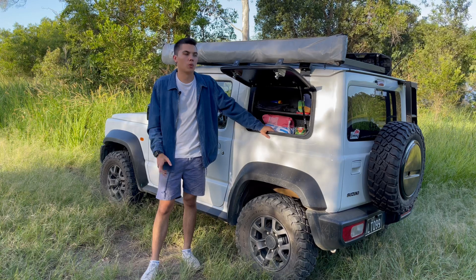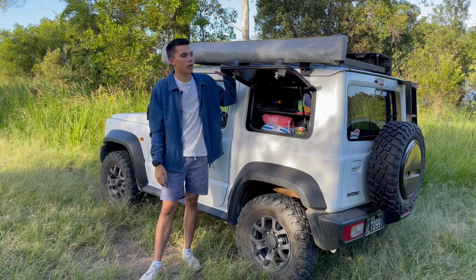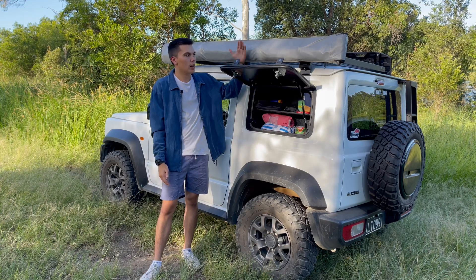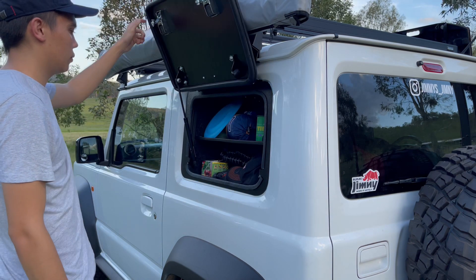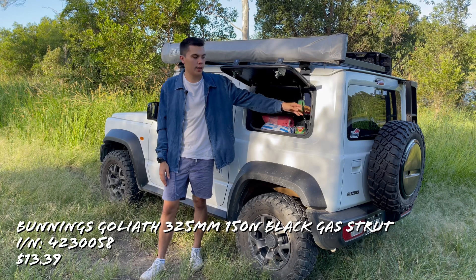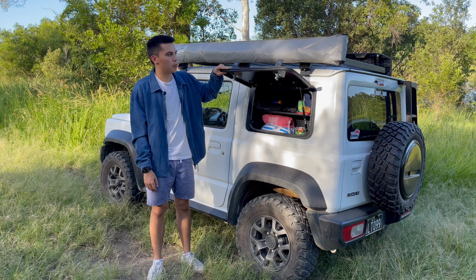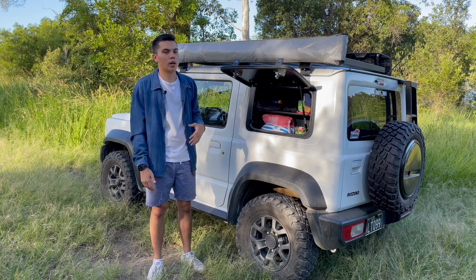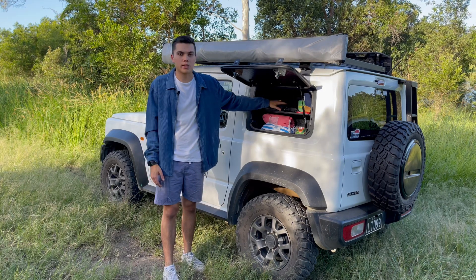One of the main reasons I got the passenger side was to use the Gullwing underneath the awning. What I found was the gas strut that came with it was actually too long — it was opening all the way up against the awning, so I wouldn't have been able to pull the awning out. So I went to Bunnings and picked up a $13 gas strut — I'll leave the link in the description — it's 325mm and it stops the Gullwing from opening too far so the awning can come all the way out. I do lose a bit of head height, but it's a small car and I can still easily access everything inside.